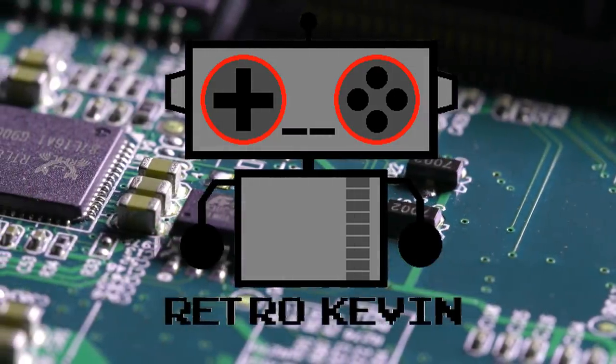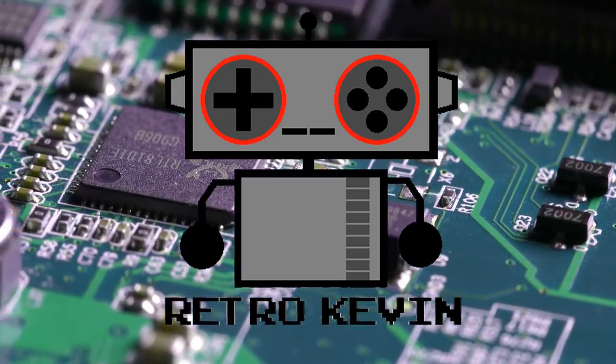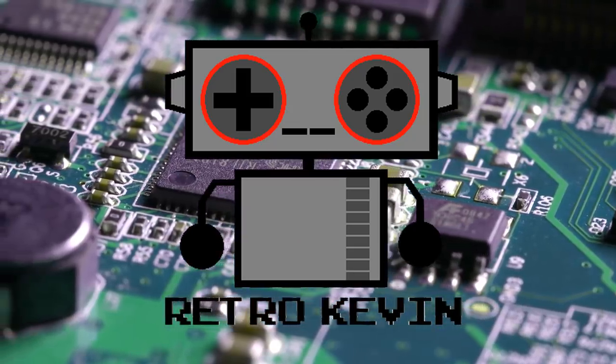It takes about 45 seconds to cycle through all the different colors. And there we go. Using a color-changing LED, or you can use whatever color you want, that only costs us a few cents, and some basic soldering skills, we were able to mod the red light in our original NES.